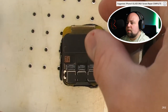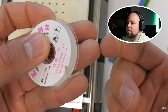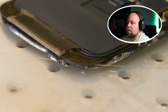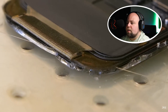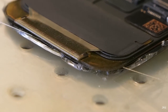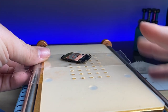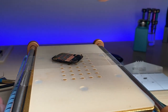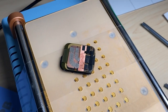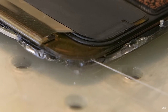Going back to our vacuum hot plate screen separator machine, this time I'm going to use some high tensile strength super thin gold-colored wire that I'll wrap around my finger to keep secure. This wire is going to be placed directly under the glass layer of the Apple Watch screen, but above the digitizer and screen layers. It's a small, fragile sandwich of high-tech components — if you pick the wrong layer to slide through, the whole thing is destroyed. Now I have changed the technique slightly — I do secure it a bit more so it doesn't move around as much. At this point he did hand the reins over to me. He had gotten pretty far in the repair and I wanted to make sure it was successful, so I did the wire work here to remove the screen.